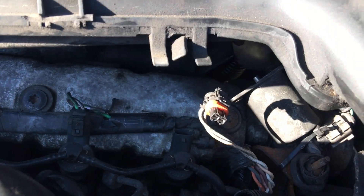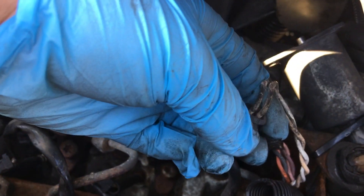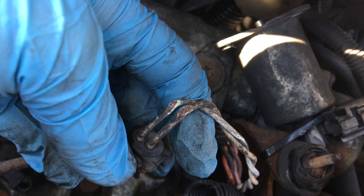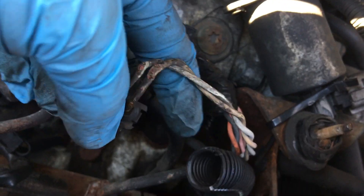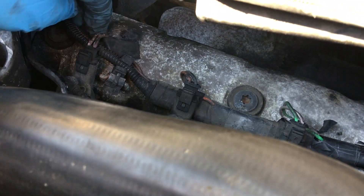Old Faithful has developed an annoying fault that materialised at the end of our last trip. The cables are rubbed through on injector number 4, so it's complaining of low voltage, which came up on the code — it said low voltage number 4. The glow plug light keeps coming on and the engine keeps hunting, so I'm assuming that's failing and stopping injector number 4 working properly, hence making the engine hunt and maybe underpowered, which is quite annoying.